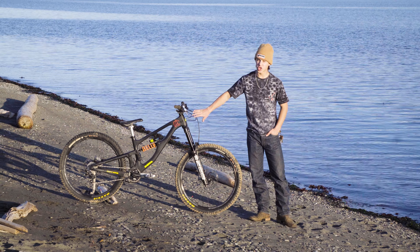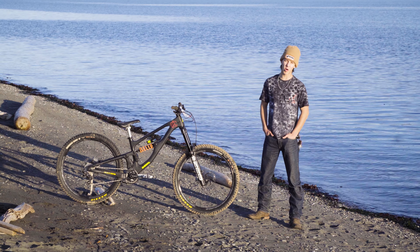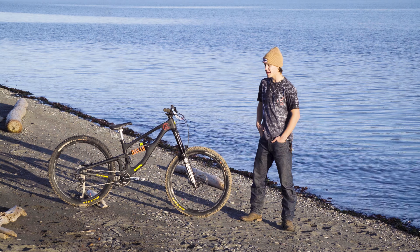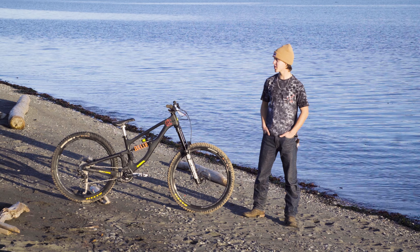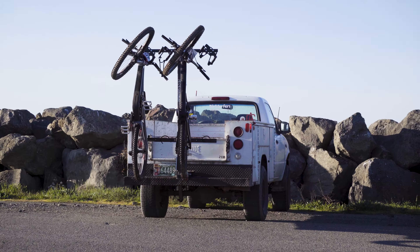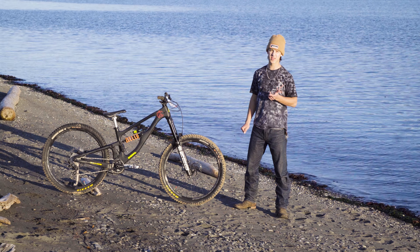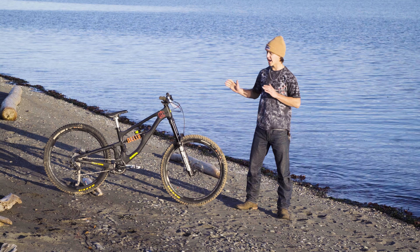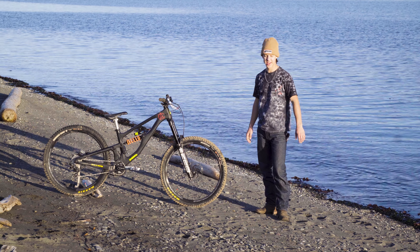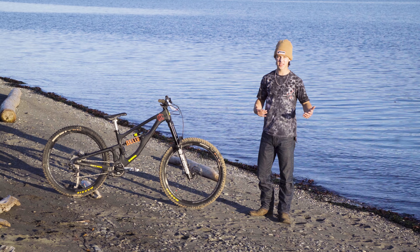To start, we have the Sherpa Olympus frame. This is a frame made by a small brand out of Colorado and they're amazing. You can build it a couple of different ways — you can run it full 29er, full 27.5 like I do, or mixed wheel sizes, so it's super versatile. With different linkages, you can run 160 millimeter travel, 170, or 180, and currently we're developing a 190 rear end. So it's a super versatile frame for a lot of different disciplines.